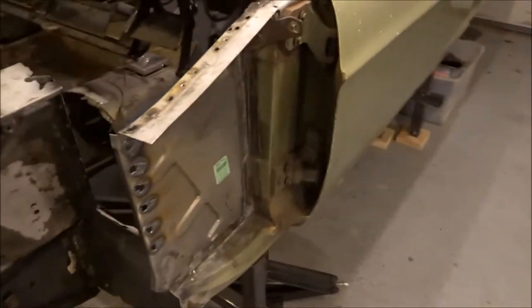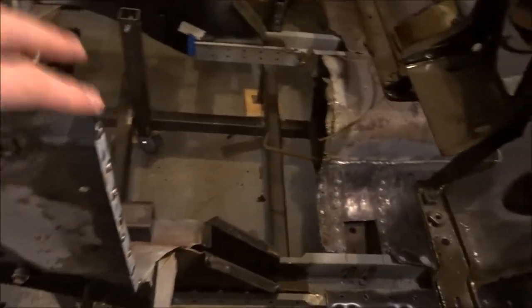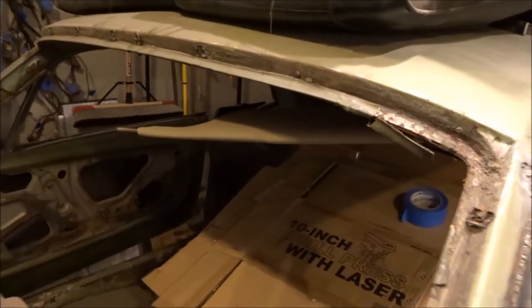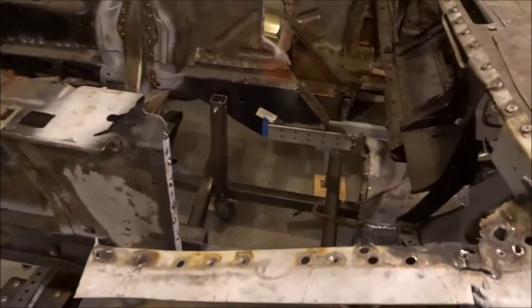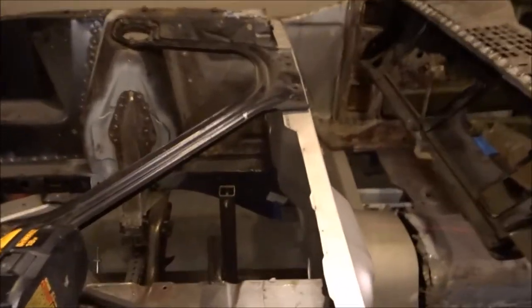Part three is going to be expanded out a bit. I'll get the new firewall in using the export brace and all the bolts, then start disconnecting the front frame rails. There's a lot of work before I can do the fastback conversion, but it'll make the conversion much easier since the new panels have the toe kicks in place. I want to get the firewall lined up correctly so this lip meets the other lip in the correct spots, aiding the install of the actual side structure.